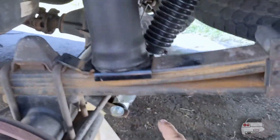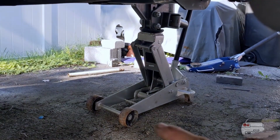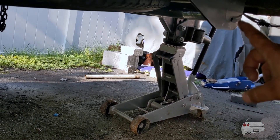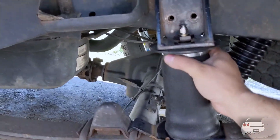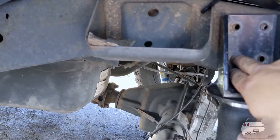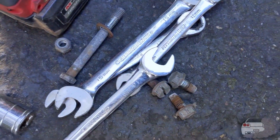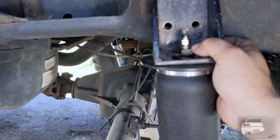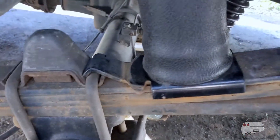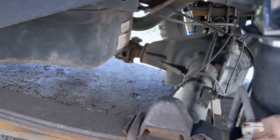I've got the bag sitting where it needs to go. I have my axle supported on two jack stands, and I'm jacking the back of my truck up by the hitch — or you can use your bar, cage, or spare tire, whatever you feel comfortable with. Jack the back of your truck up but not so much that it comes off the jack stands. This bag will basically fit right in here and the holes line up where they were. One of these holes gets a bolt straight through it, and the other three get self-tapper thick bolts.